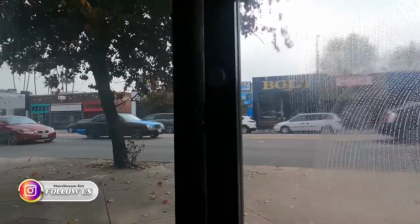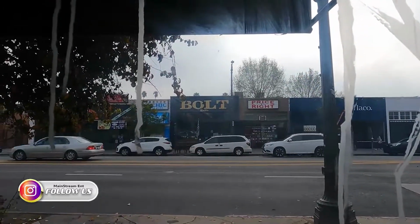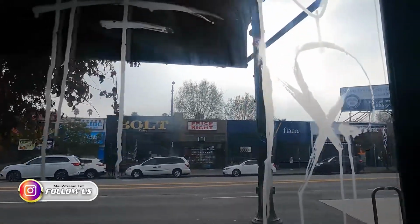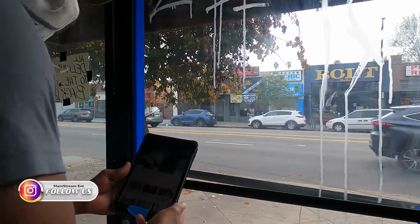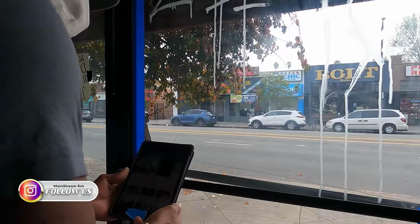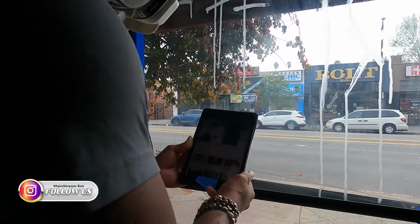And what I did not show is I put tape around the edges of the window, because when you're sanding, it produces a lot of heat, and this will help with the window not cracking. I also outlined the graffiti with a marker, so I know where not to go too far out, so I don't do too much work.